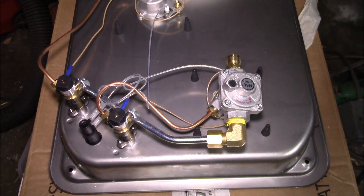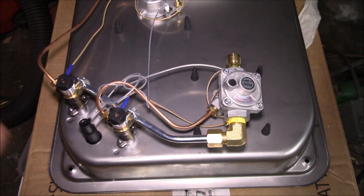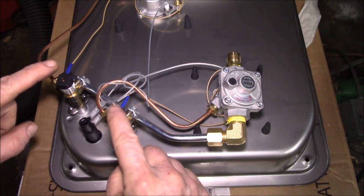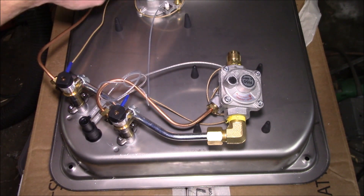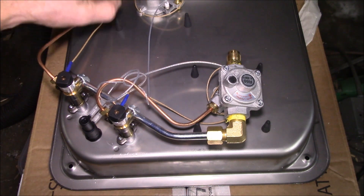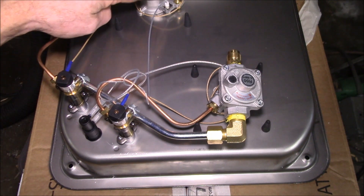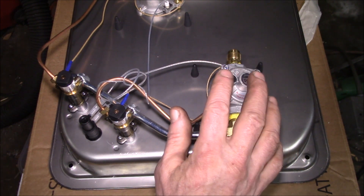Good afternoon YouTube. This is the bottom side of the two-burner combination cooktop, or hob. This was set up for propane, so it has a secondary low-pressure regulator, which feeds the two burner valves. The burners have a piezoelectric start — this is the piezo right here, the clear wire — and each valve has a thermocouple that goes back and shuts off the gas if the flame goes out, which is an important safety feature.